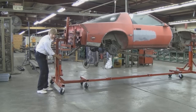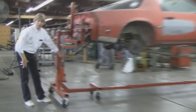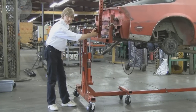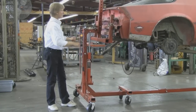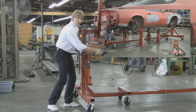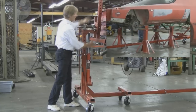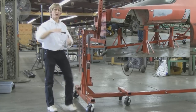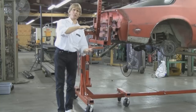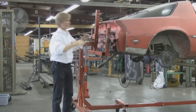You're going to do most of your adjustment through this jack here — 3,000 pound capacity. You've got one jack on this side and one on the right hand side of the screen just out of the view. So you're going to jack both sides up, get it as high as you can, put your barrels or your other jacks underneath to hold it, and then go ahead and dial in your center. The center is the center of gravity, so you've got about 10 to 30 inches there that you can adjust up and down to get the car balanced.